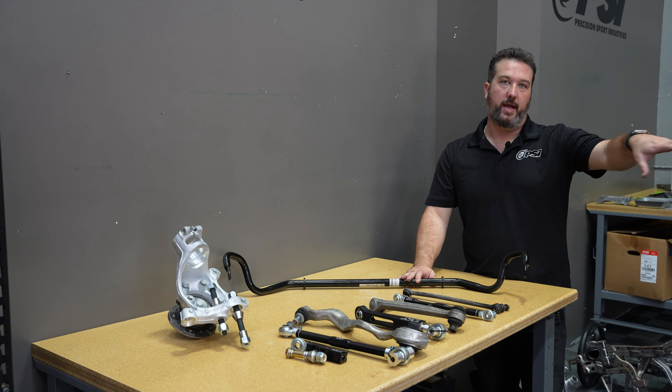Something never overlooked with a StopTech brake kit is that they include the Goodridge stainless steel brake lines, which replace the rubber lines that normally expand under high temperatures — and these cars are over 10 years old, so that's a must-change item. It comes included with the big brake kit. The other cool feature is quick-change pins on the calipers: you pull out this hardware, it comes out, and you can quickly change the pads.